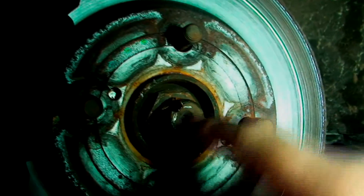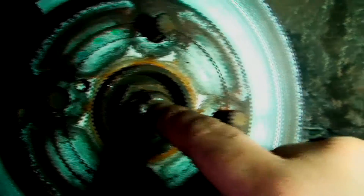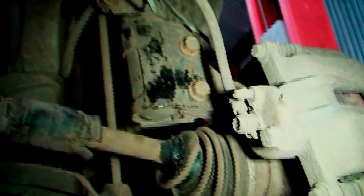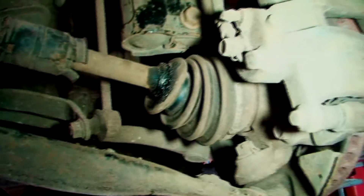Just the thing to be aware of when you tighten the CV bolts: there's a little cutout in the CV joint, and you just need to hammer down that little bit of metal — it acts as a lock-nut. Now this is all tightened up in here. As we can see, the CV boot is gone — this is the CV boot, by the way, people. Not to worry though.